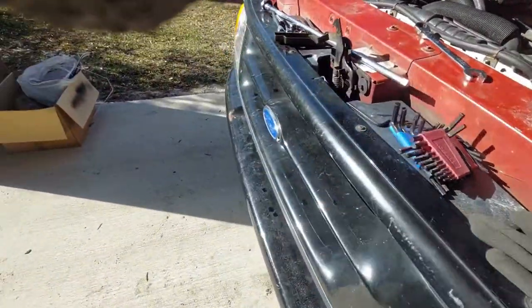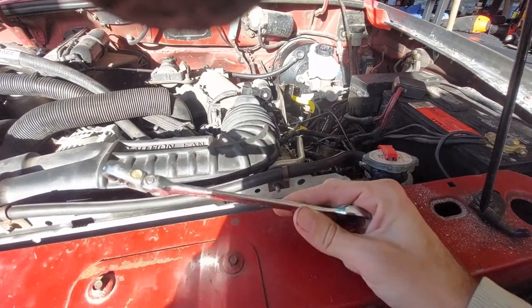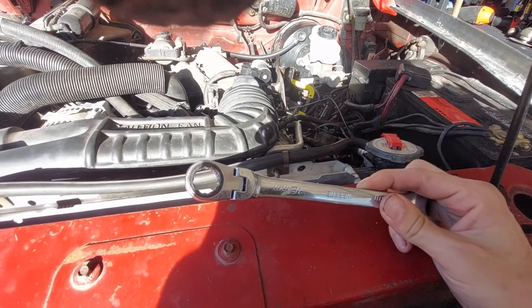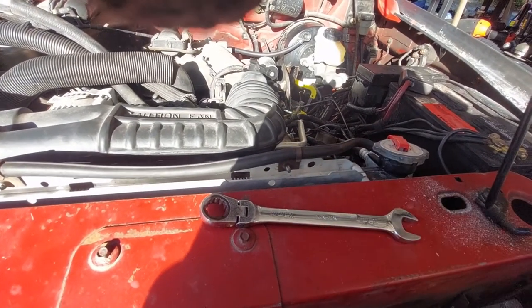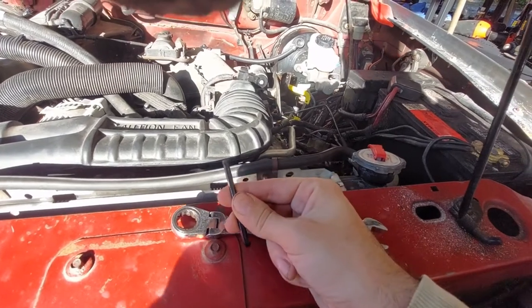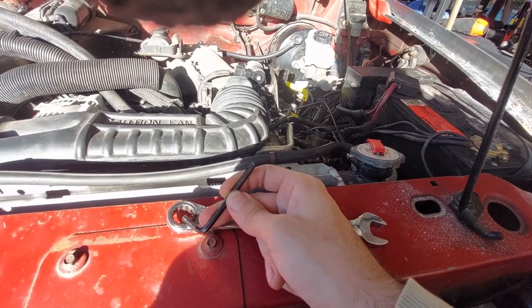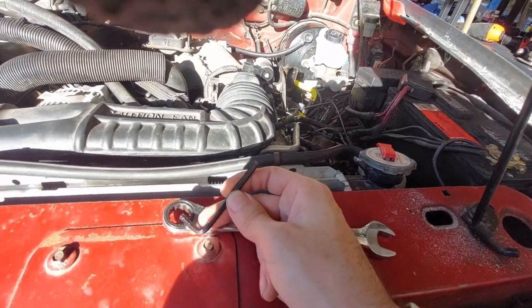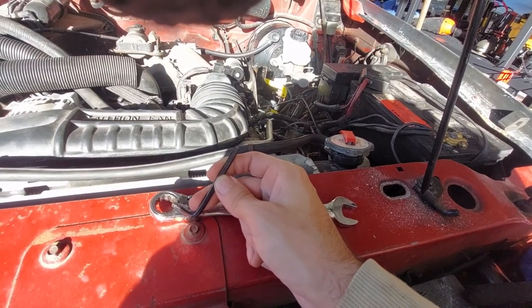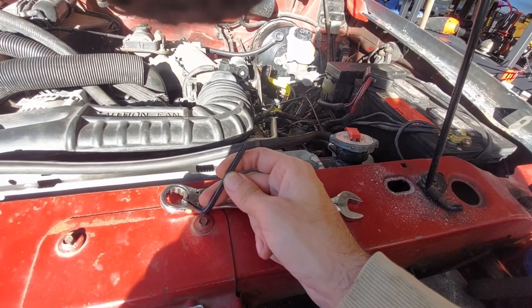It turns out a 16 millimeter will go around that locking nut perfectly. What I did when tightening up after adjusting: I took my hex/allen tool out, put the 16mm on the nut, put the allen tool back in, and at about 12 o'clock there's something to hold it against. Then I used the ratcheting open-face box wrench and got it nice and tight. Also, you're going to leak a little bit of power steering fluid while testing with the engine on when it's loose — that's normal. Once you get it nice and tight, that leak will stop.